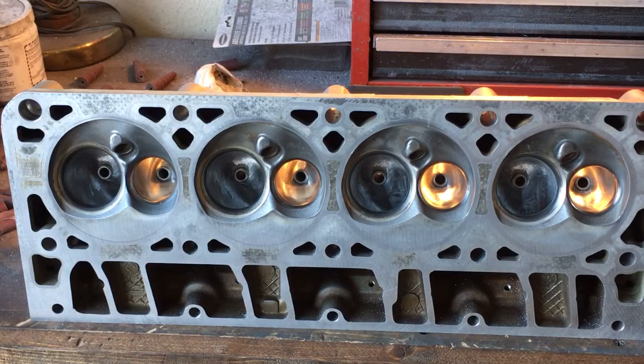I want to give you guys some math. The intake bowl cut ended up at 88.5%, so I got an 88.5% bowl cut and blend on the intake valve. It could be just a hair over — as best as I can measure with my dial calipers, it's a 1.77-inch bowl cut, which is fine. That's within half a percentage or less of the 89% I was shooting for.